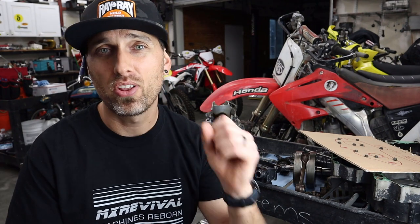The big hot pot, that was pretty cool. I've never done that before. I figured I have this gigantic thing sitting around. I may as well try it. And much to my surprise, getting the cases just warm enough, some of the bearings were just falling out. So that was pretty cool. I tried like hell to get the shot with that blind bearing puller for you. We finally got one at the very end.